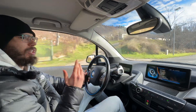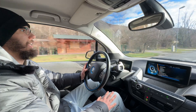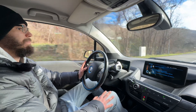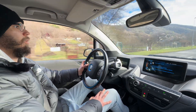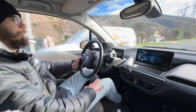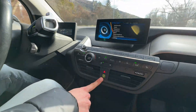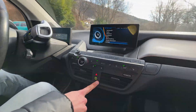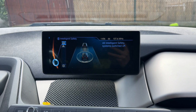If you go into roller mode trying to have fun and take all the assistance off, be very careful — if the motor is allowed to spin up really quickly when there isn't enough traction on the rear axle and you suddenly hit a patch of road with good grip, you will put a lot of pressure on the motor mounts and if you do this repeatedly it will snap those off. Also, if it's raining heavily or snowing — especially in the dark — the adaptive cruise control system, if your i3 is fitted with it, can occasionally freak out. You can deactivate it: by default it's in adaptive cruise mode, but pressing and holding the distance button switches to manual cruise. You get a 'distance control deactivated' message in the dashboard and can then use cruise control as normal, though it obviously will not slow down for traffic ahead.